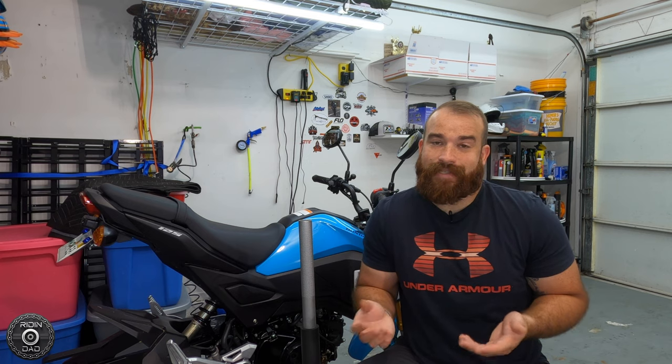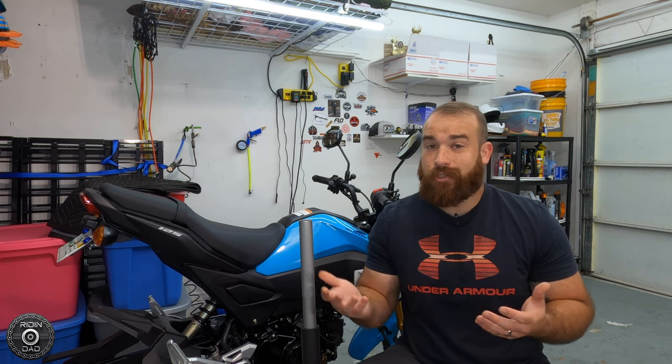I'm not gonna give you my impressions on this setup first because I haven't ridden nearly enough miles on it for me to tell you what I think about it. I don't do reviews like that. I make sure I vet the products before I tell you guys my opinion on them. But I can tell you just from installing it that the quality of the product looks pretty high. And I mean, it's 6 discs. It takes up the same amount of space, but it's smaller. So it should have more of a positive engagement and possibly give you more of that friction zone to kind of play with, because the stock Grom, there's almost no friction zone. It just slips all the time or is just kind of engaged.